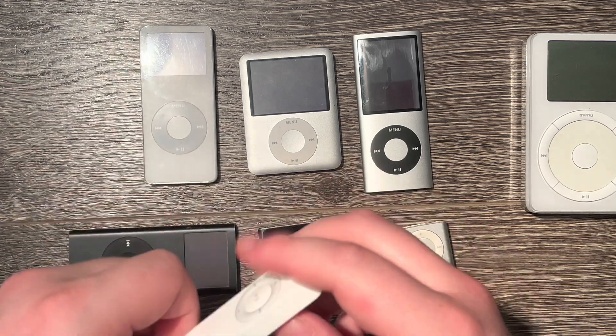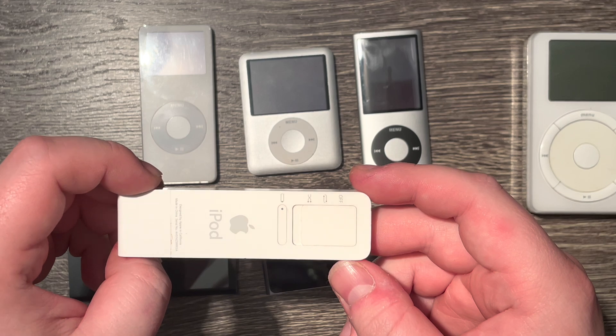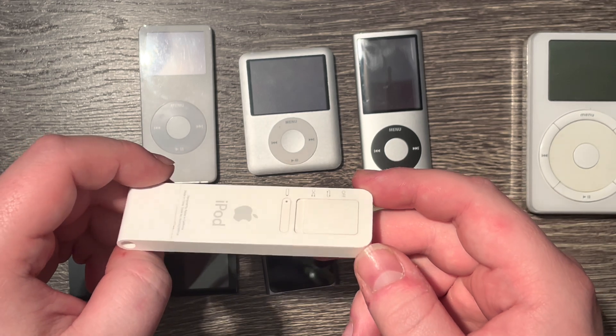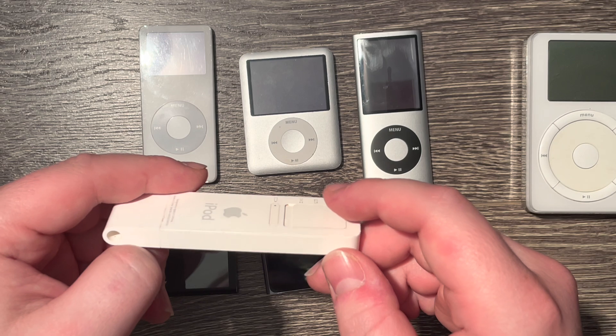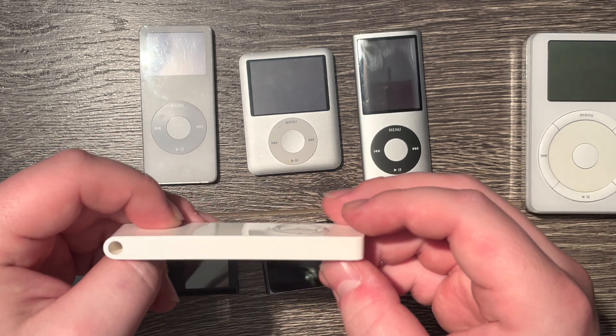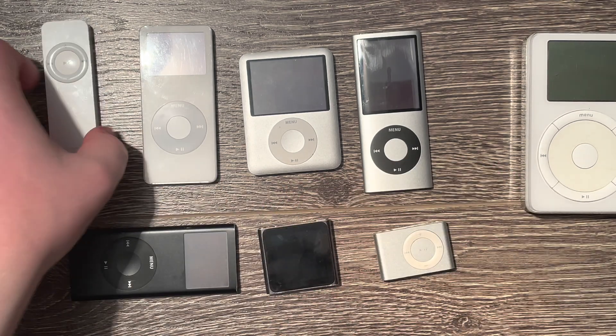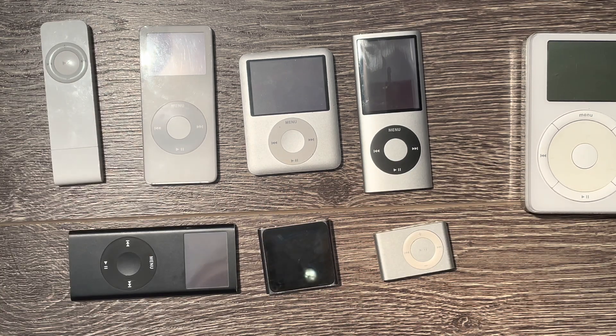With first generation shuffles, these are very rare when they expand — they usually just completely stop working when the battery fails, but I've seen one or two that expand. They push against the controls, get very warm, and become very unstable. iTunes doesn't recognize them or struggles to recognize them, and then iTunes kicks the iPod out because the battery can't sustain the power — possibly because your USB port doesn't have enough power to feed the iPod with no battery to help it.